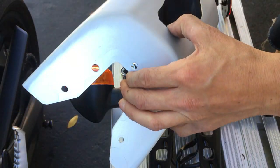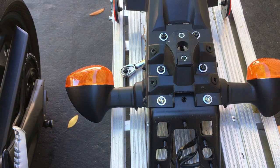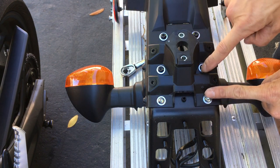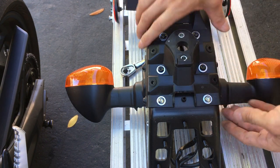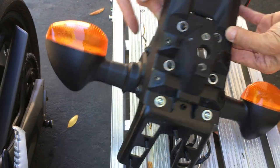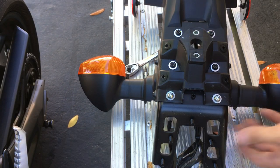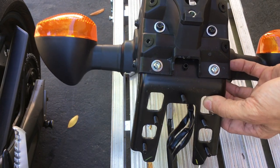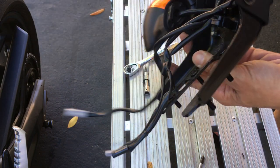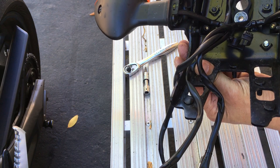All right, so here's the fender. We take this off and set that aside. Now we have all the bolts here exposed, so we're going to separate this piece out here. There are six Allen heads — looks like they're number four and number five millimeters. Six of them.